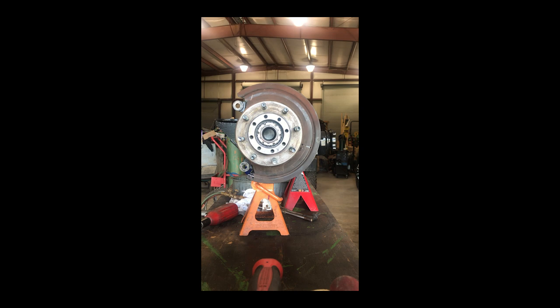It's really neat. I saw another guy do this — I was trying to find another shop that would straighten the housing after I had welded on it, and nobody was willing to straighten it. Thankfully, I bumped into a guy on YouTube showing how to do this. His was a 10.5-inch 14-bolt out of a rock bouncer — they were putting a top on it for a four-link. This one doesn't have that crown-type setup; this is an 11.5-inch out of a Dodge truck.